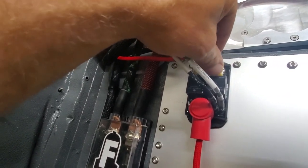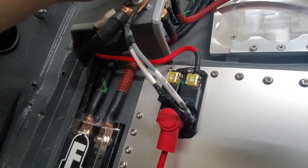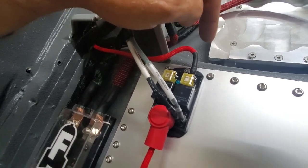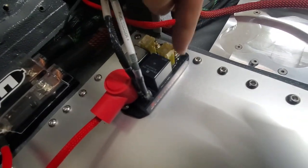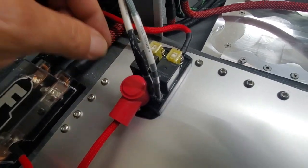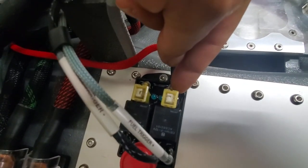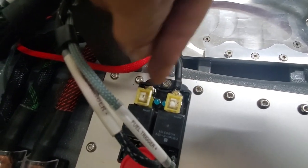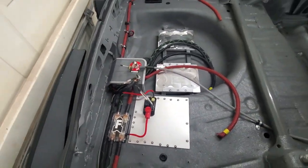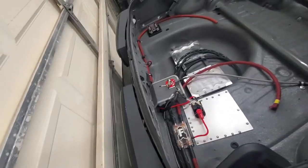Power in, power out, with these fuses. So if something happens down the road or this relay goes out on me, I can simply come over here, unplug the trigger wires, plug them into this side, disconnect this line, plug it onto that side, and I'm back in business — fuel pump relay, two for the price of one. Just a little insurance.